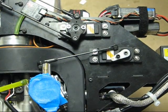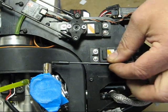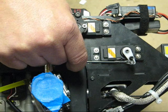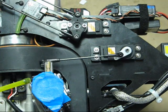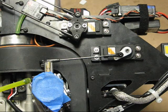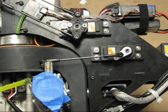Then what I do is put my trim back to center, go to full throttle, and adjust this link so that when I pull to full throttle it mates up on there. When I go full throttle it sits down on there and now I've got my correct link length, so I'll go ahead and snap that on. By doing it this way, you get a nice idle somewhere around center trim — you may have to go one or two clicks one way or the other depending on your engine. You're going to find that when you bottom out your trim it's going to bind just a little bit, which is not that big of a deal — just don't ever drop your throttle all the way down. So now we've got our travel set up: that's full throttle, and that should be about idle there.